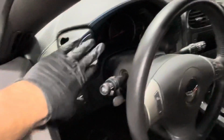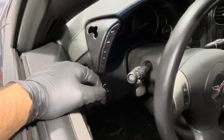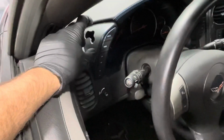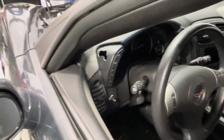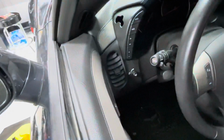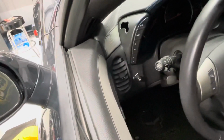Can you believe it? It's not like it's a 12-year-old car or anything. They don't make this thing, so now I've got to figure out maybe breaking into my neighbor's car and stealing his or something. Whatever the case, I'm going to have to find it. I used to have a gauge pod here with a little Innovate wideband, ethanol sensor, all that. And the ground lug was down there on the driver's side rail. I had it disconnected, so of course when testing for power, I had none anywhere.